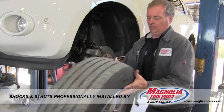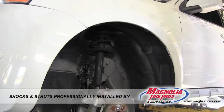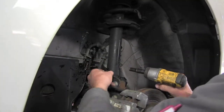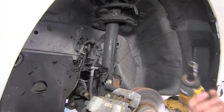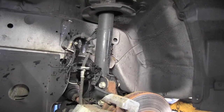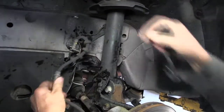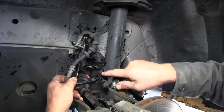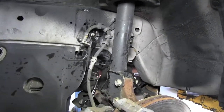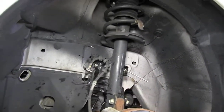As you are moving the wheel, loosen these little bolts for the wires — that's just my preference. It's a 10mm socket and a little 3/8 hand impact gun. Wiggle and pull backward and the brake line will come free of the strut. That bolt was holding the wire for the anti-lock brake. Use a wrench to hold the stabilizer bar — that's a 16mm.